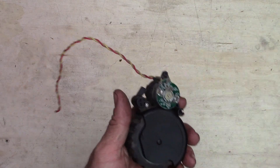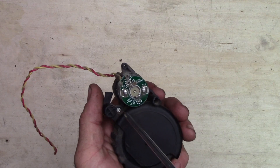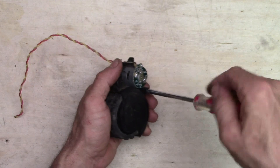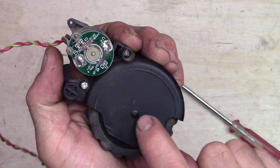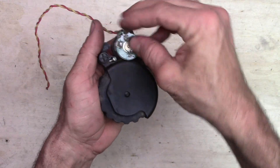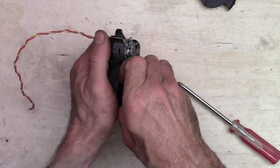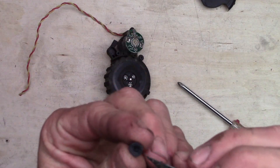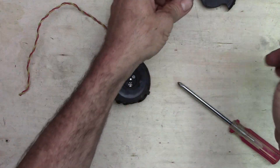The other side is where the planetary gear lives that drives the wheel. There are two screws to take out to get this cover off — one is there and one is down inside that little cylinder. Also right here in the middle is a little teeny bushing that you have to be careful you don't lose. It's very important to keep that; it helps hold everything together. Let's pull that bushing out. Now you want to look in that bushing if you are doing one of these cleanings — make sure that there's no crud right in there in that center hole. Hair and stuff tends to gunk up in there.